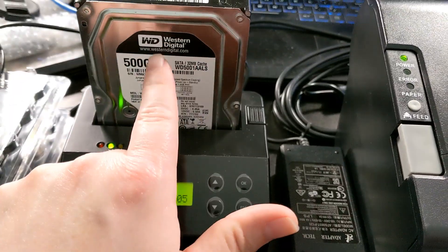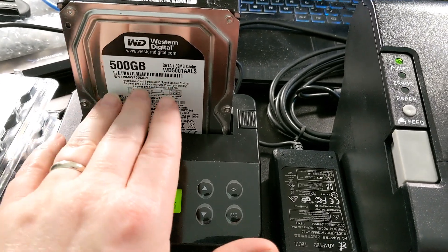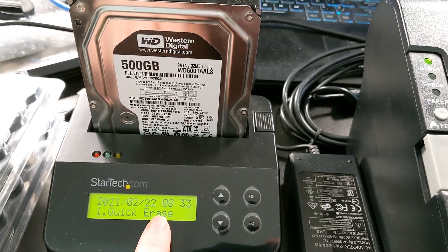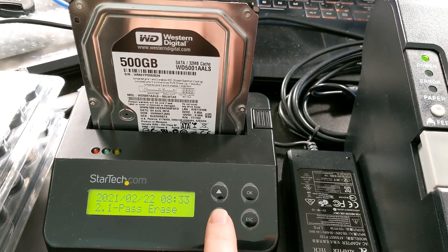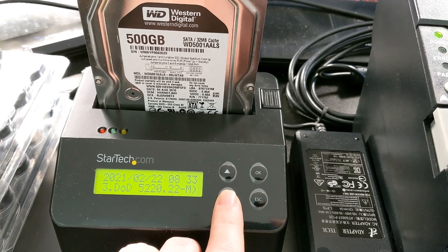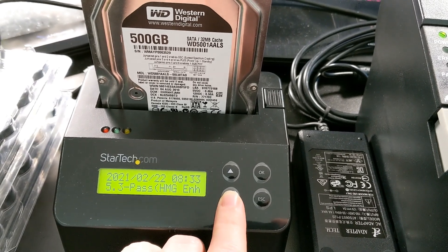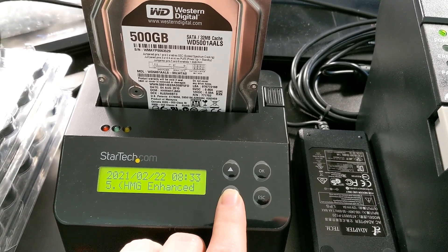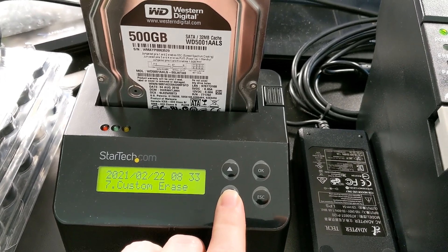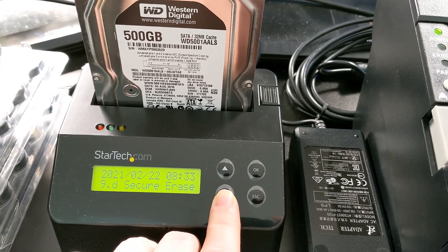Real quick, you can see I've got a 500 gig Western Digital black drive in here, and these are great drives. It's got time and date. Option number one is a quick erase. We've got a one-pass erase, a three-pass DOD5220.22-M, a three-pass — you can see the standards there — another three-pass, a seven-pass, a custom erase, a secure erase, and an enhanced secure erase.